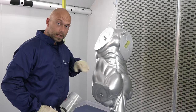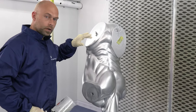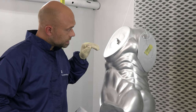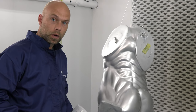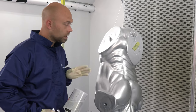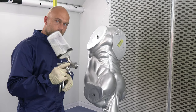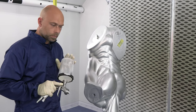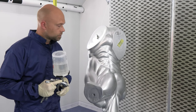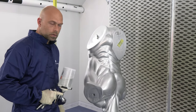We're back. I'm ready for my second and final coat of clear on all the parts. All the other parts are done — this one has one coat on it and it's just about ready for a second. I was initially planning on doing three coats, but this came out really clean and there are no serious issues I'm trying to bury, so two coats is where we'll leave it. We're doing a solvent urethane clear coat and I'm using my Iwata Supernova, a 1.3, which is my clear gun for everything. Right around 29 PSI in the gun, fluid control wide open. I'm ready to start spraying my second coat.